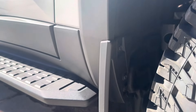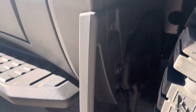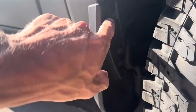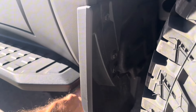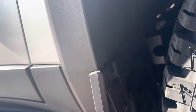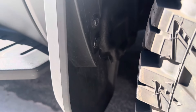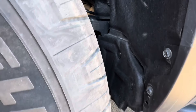We need to remove this piece right here, and to do that we need to remove this. To remove the mud flap: hard bolt here, hard bolt here — retain those, you're going to need them. Undo this right here, and there's one bolt to the mud flap right about here. You're going to remove this, which will give you access to remove this. That's how you're going to avoid rub.